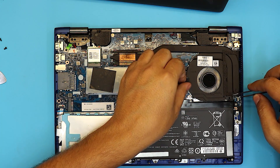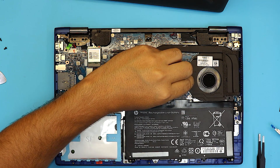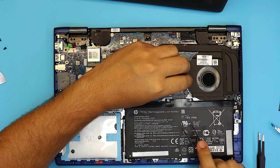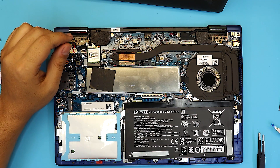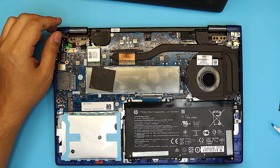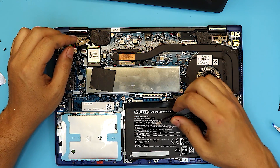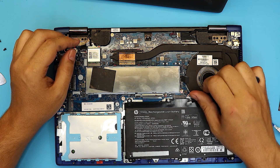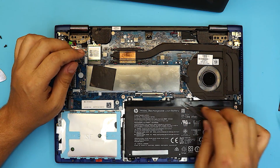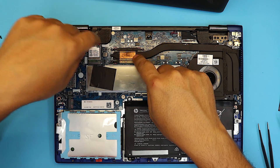I'm not going to rip this foam, so I'm going to lift and remove the whole fan with the heat sink together, and disconnect the fan. If you want, you can go ahead and remove the battery first, but there's no need if you're cautious. Removing the battery requires removing six screws — I made a video on how to do that and I'll leave the link in the description. Next, remove the four screws that hold the heat sink to the motherboard.